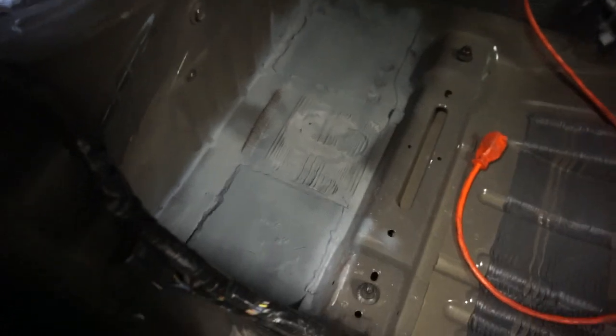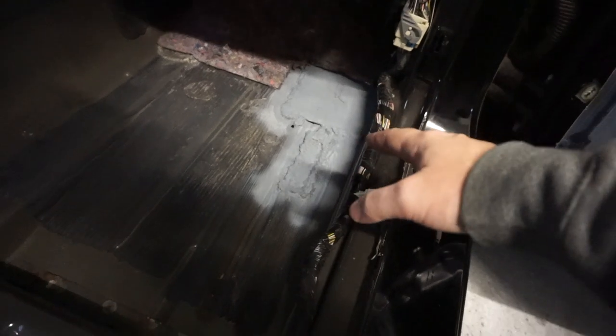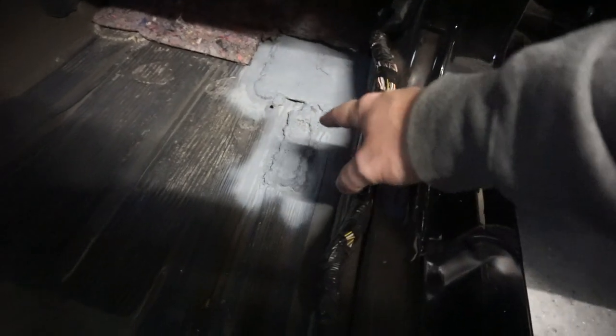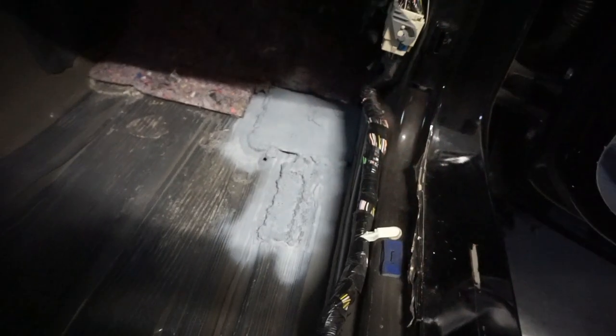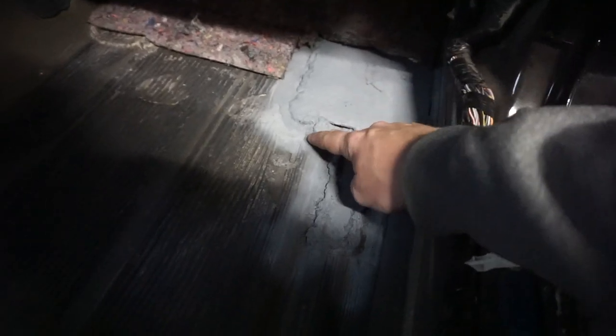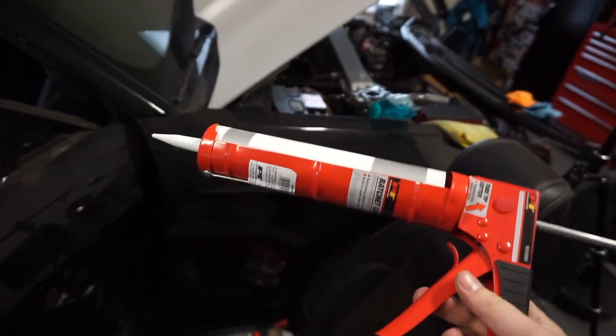As you can see we've got some spray paint going on here. I also had to weld the floor pan — never welded a day in my life — I picked up this Harbor Freight welder from my uncle, just borrowing it, and kind of taught myself how to weld. I finished patching it; it's obviously not pretty but I got some boogers laid down to seal it up and a little bit of paint on the surface to keep it from rusting. There was a hole I was trying to weld up but that ended up arcing the floor pan and melting it, so instead I picked up some seam sealer and a caulking gun.